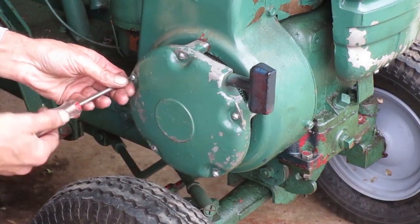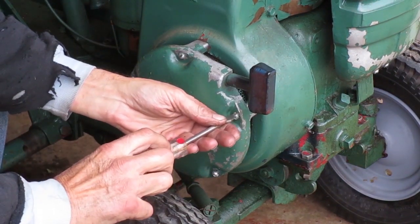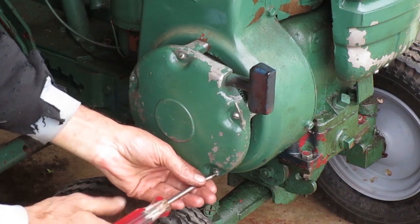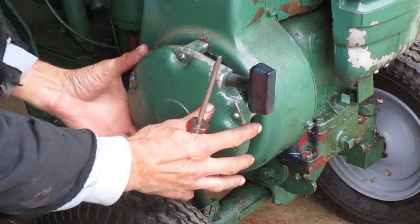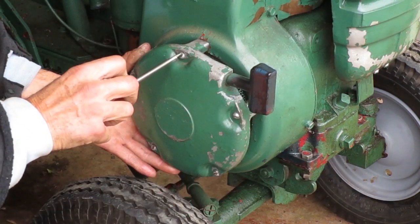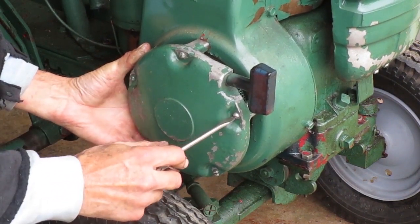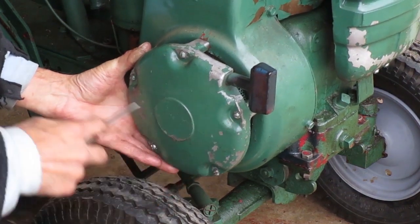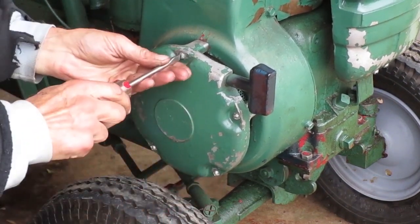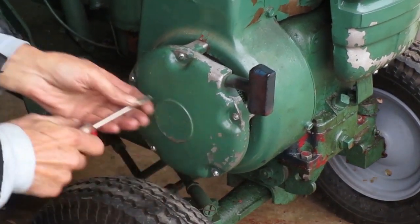When I put the screws in the first time, I snug them up and back them out half a turn. Then when I have all of them just a half a turn loose, I rotate the starter one way or the other and hold it rotated while I tighten the screws. That should get it close to centered in the flywheel cover hole. Some starters will have a little pin that lines the center of the starter up with the center of the crankshaft. If you have a pin, tighten the starter where the pin wants it to be.